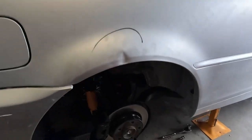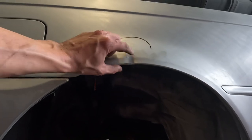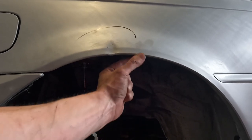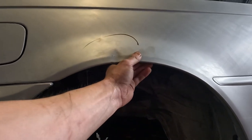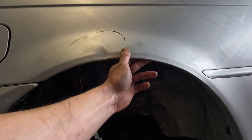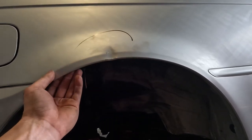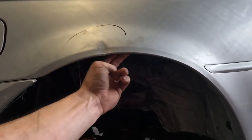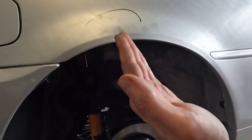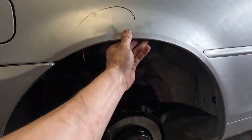That is the driver's side done - same result. This actually came out a little bit, which was nice, but we'll sort that out at the panel shop. So I have gone from a deep 25mm overhang to, like, a 14-15mm. Worst places it's like a 14. So yeah, it's kind of really good. I'm just going to give this a little bit more of a massage because it kind of goes like that a little bit. I want it to just dip in a little bit, and then we're good. Then I'll spin the car around and we'll do the fronts.